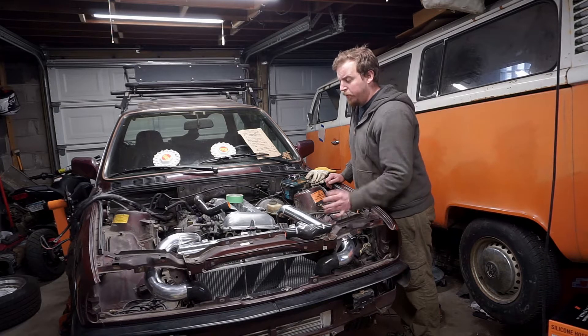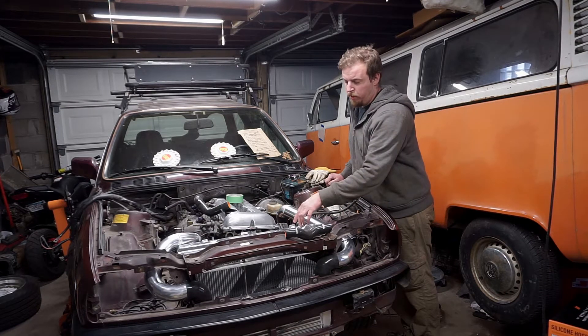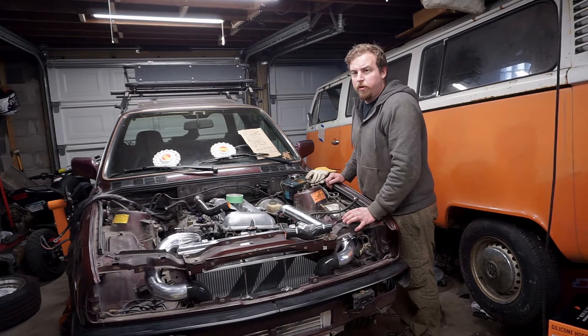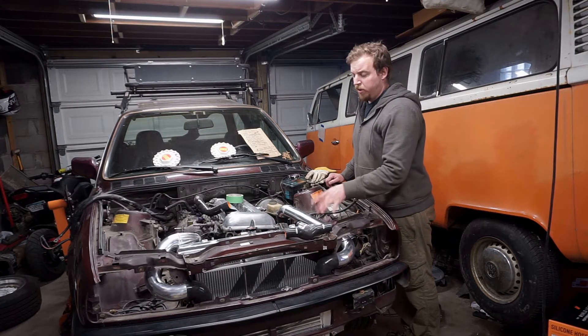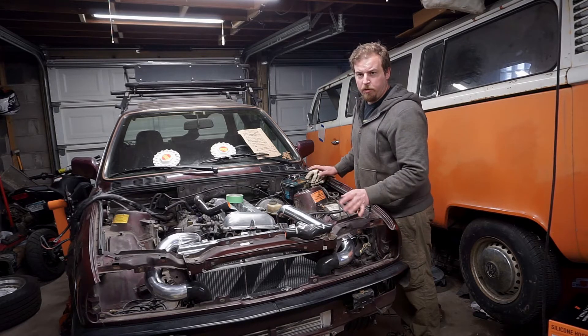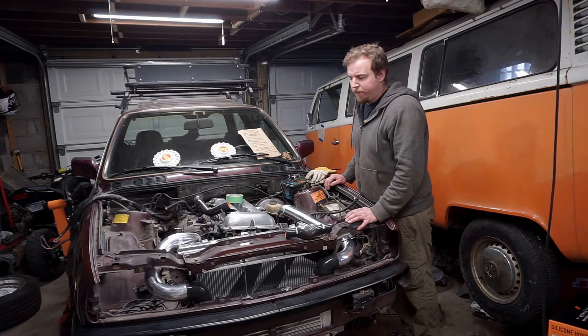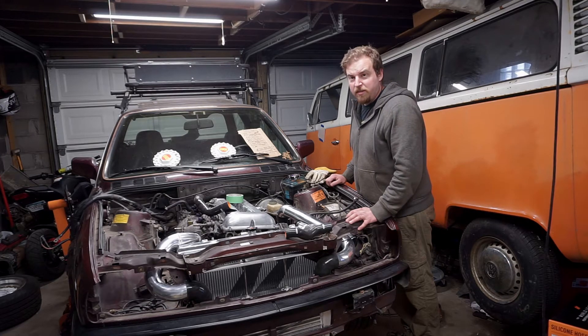If we don't like where it's at, that's why we tacked it in place — we'll cut them and redo it. But if we're happy, we'll move on to the top. We're gonna use the top studs on the radiator. There are actually two bolts here and here on the radiator support that we'll make our brackets for the top, so everything can be removed with ease. It's just a radiator so it shouldn't move around too much — just want it to stay in place. That's the game plan.